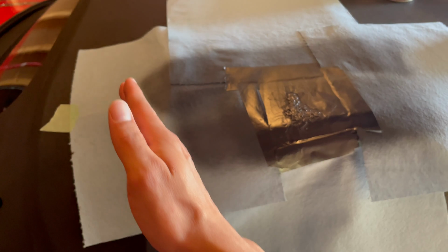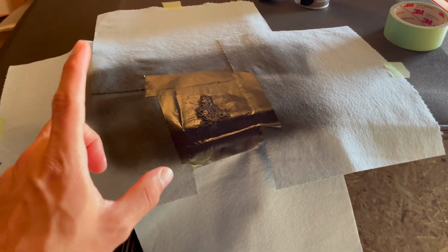All right, we just did a couple quick passes on the vinyl repair that we did. Just maybe it was 1, 2, 3, 4. Quick rest, 5, 6. When you spray, you don't want to start directly on it. You want to start to the side and give it a spray over, start to the side and give it a spray over. Don't start right on the direct spot that you're wanting to hit. Just make sure that there's less splatter. The first initial press will kind of give a quick splatter, where afterwards when you're moving, it's a lot more uniform. So to avoid any sort of splattering, generally a better thing to do.